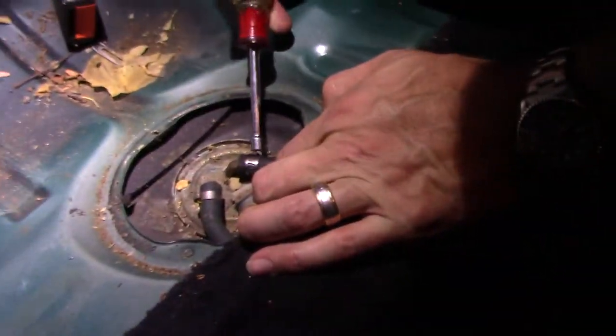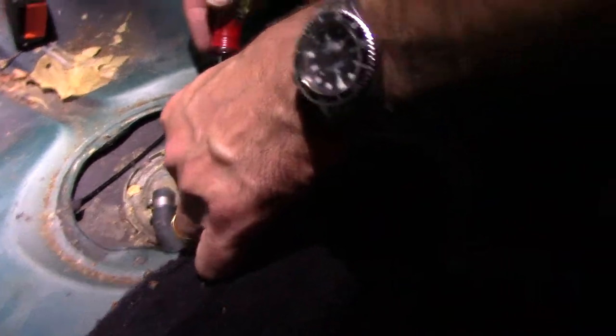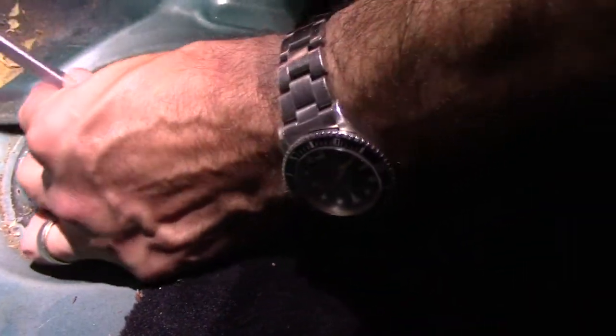Since this thing has obviously been out once before — it would have had a band-type clamp — this is the one we pulled off for the test, so I just need to loosen that. I'll have to come up with a screw-type hose. Apparently we have an evap problem too, because it shouldn't push pressurized fuel like that out of the tank.